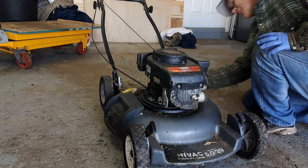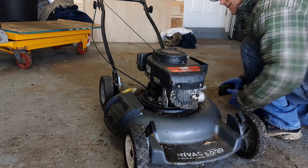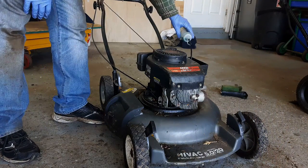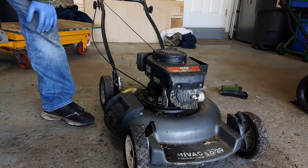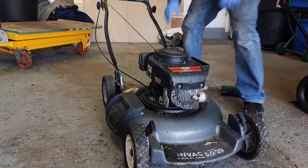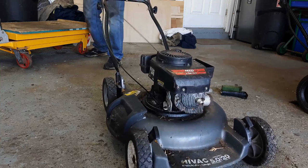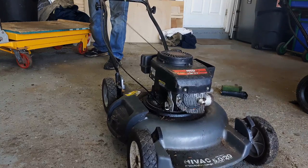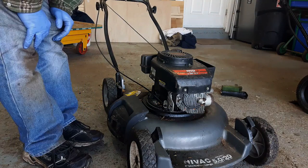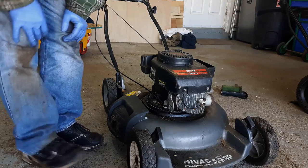The next thing I'm going to do is try and put some fuel directly into the carburetor and see if she'll fire up. To do that I'm going to put some fuel into where the air filter is and try to get that up into the carburetor. The fact that it fires up means it has spark and good compression, and typically when it fires up and doesn't stay running it's most likely because it has a gummed up carburetor.